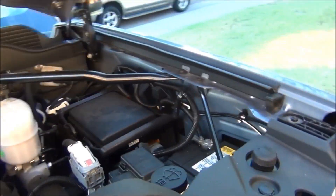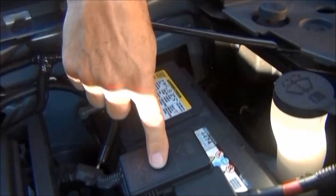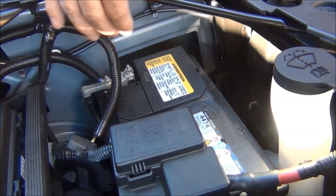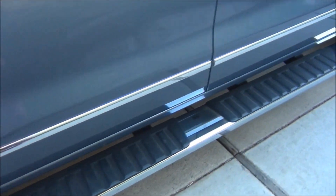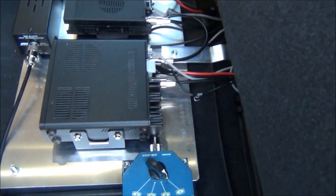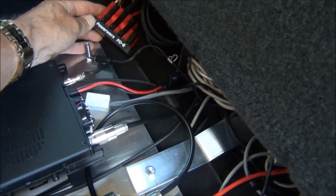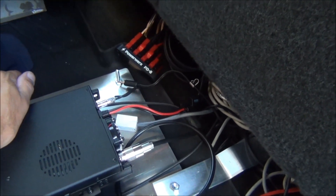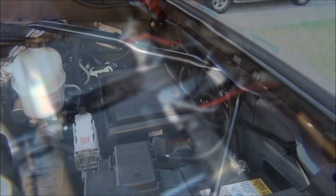My plan is to bring power from one of the batteries right over here — there's a power lead underneath and the ground is over here — and run both ground and power from this battery underneath the truck, under the cab, to the back, and bring it in through a vent to power these radios. The current cigarette lighter power source comes to this distribution block, so I'm going to have a bus bar box back here that this will plug into to draw its power.